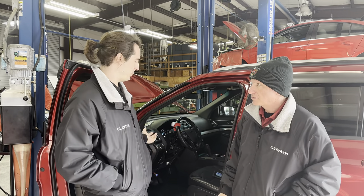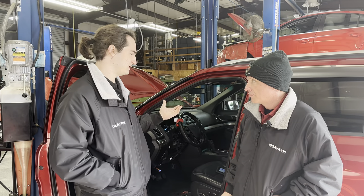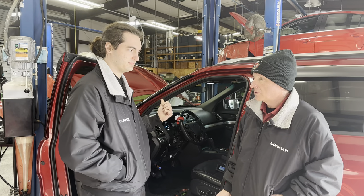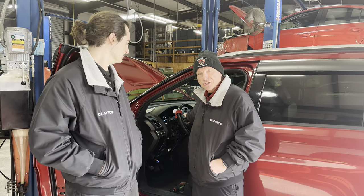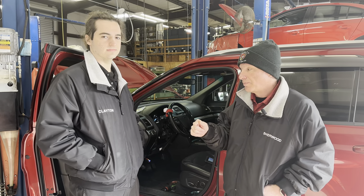The testing procedure involved pulling the airbag out and then getting access to the SRS module, which is in the center console. You'd have to pull the center console out to unplug it, and then test the resistance through all the wires to the airbag. That's a lot of time. So we're going to show you a way that's way faster and requires not getting to the module whatsoever.